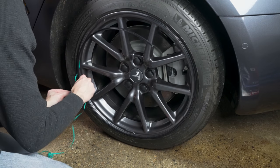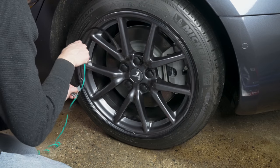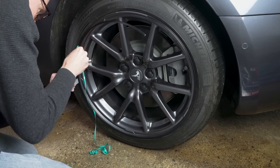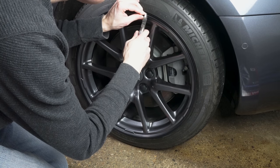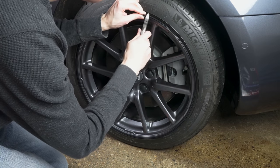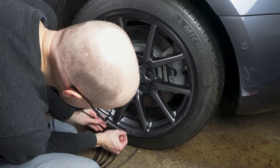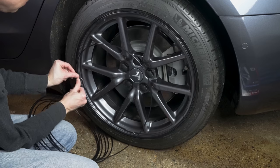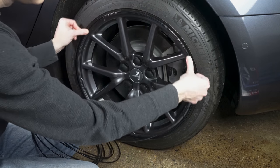Start by removing a few inches of the adhesive backing paper and then just press it into place along the edge of the rim. Try your best to keep a consistent placement along the entire wheel as you go — they even provide a tool that can help you do this. At the end, just cut to make a precise fit and you can move on to the tubing insert. Rough cut the tube to length and then snap it into place within the track. You should offset the tubing cut to the opposite side of the track cut, which helps with the final appearance. Wash, rinse, and repeat for each wheel, and you're done.